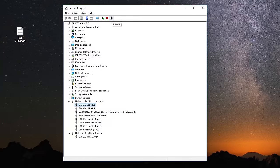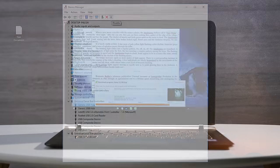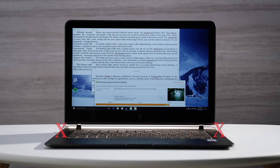What about disabling the USB ports or other devices outright? We ran one test with the USB ports disabled, and another with the webcam and IR emitters disabled. But other than being a good idea for privacy, neither of these produced any savings above our 4% margin of error. So it looks like the internet got that one wrong.